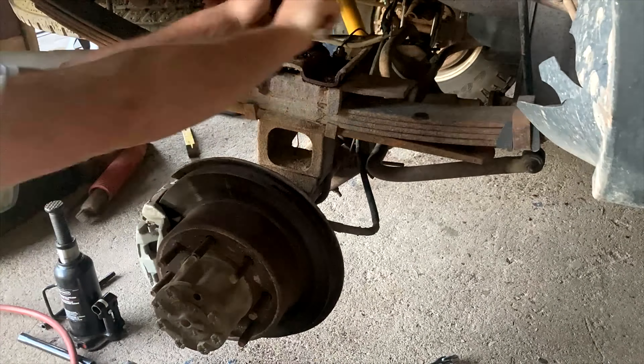Hopefully if you had the same questions or issues as me, that solves it for you. You definitely need to remove the spacer block and that broken leaf spring, and I highly recommend replacing the u-bolts as well, in order to fit the Hellwig system over top your leaf spring. The truck would just waddle down the highway, and with all that additional weight in back, trying to counter that by steering - it feels like you're limited with steering or you don't have much steering at all. Correcting the ride height and stopping that body roll should make for a much more comfortable ride, and frankly it was probably pretty dangerous.